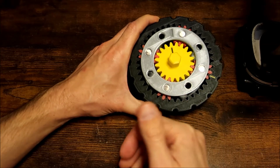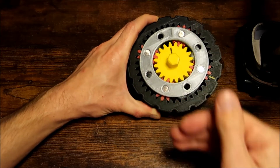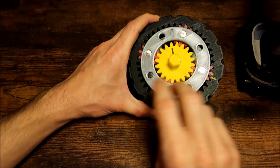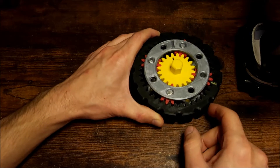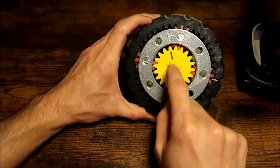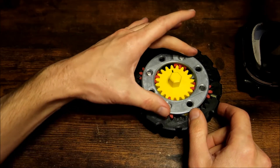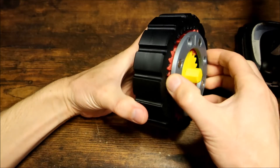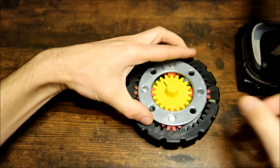So if we have 50 foot-pounds being fed into the sun gear, then due to torque multiplication, you get three times the torque — or 150 foot-pounds — coming out of there. That's how we can use gear ratios to exploit and modify the torque going through the transmission. Whenever your vehicle is starting out at slow vehicle speeds, torque is more important to get it up to speed. Then you can shift gears to transition from a low gear like three to one to something like direct drive and then overdrive. Now what I'm going to do next — same thing, my sun gear as my input drive gear — let's hold another component and see what happens.